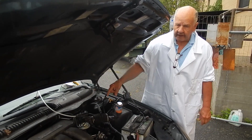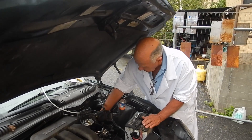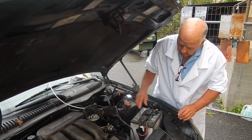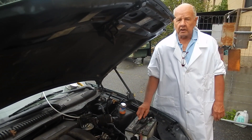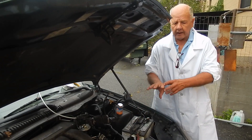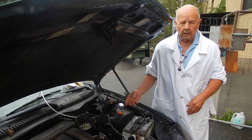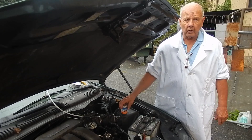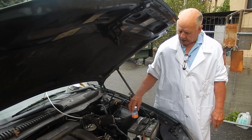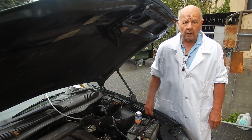So we put it back on again and I'll be damned if that 401 code didn't keep coming up. Then I decided we'd have to get the differential pressure regulator, which is down underneath here. It was designed by some diabolical fiend at Ford who decided you had to have a smaller hand — about half the size of mine — and two wrist bones to get in there. I finally got the thing out. We put a new one on because we figured that absolutely had to be the problem. And we still got the 401 code.